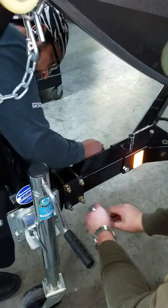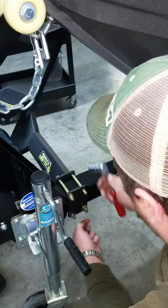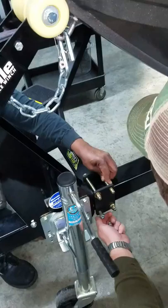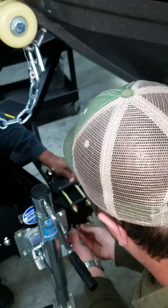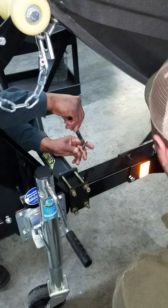He's got those lock nuts tight. He's going to take the silver nuts back off. You can throw these away or use them for something else — you won't need them for your step. It was just to help ease the installation. Put the flat washers on, two lock nuts, and get them run up tight, and the step will be on. That's all there is to that. And we still have to put the handle on, which is just two bolts and a couple of flat washers and a couple of lock washers.